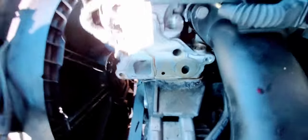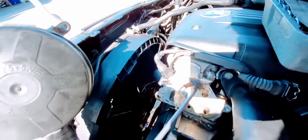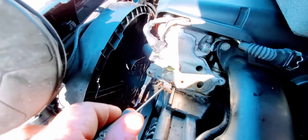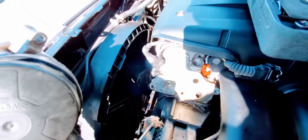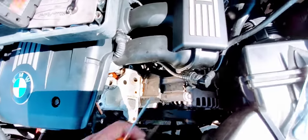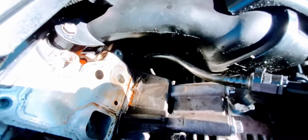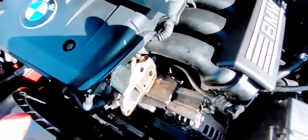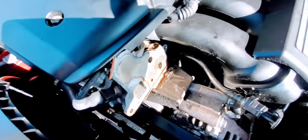Let's clean it up. I see a little bit of corrosion — the antifreeze must have been sitting there for a while. It's really not that bad overall. All this right here is what's left over from the belt. One indicator we knew this was leaking: fluid, coolant, oil, or both leaks off to the side, goes down to the belt, which then slips, tears, and breaks. You've got to dig it all out of the alternator — important to get as much as you can, because you can get a low oil pressure warning and then the engine behaves improperly.